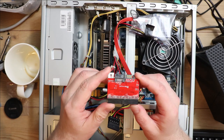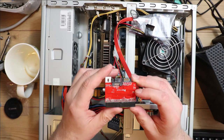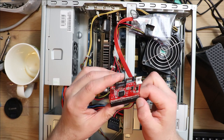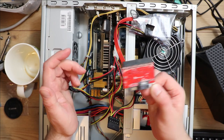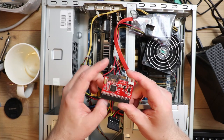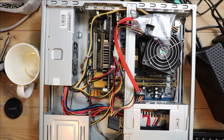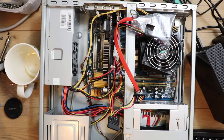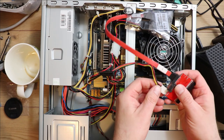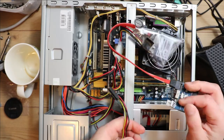Even the shutdown is slow and unresponsive — it should shut down much faster with virtually nothing installed. I also tried another red adapter and Windows fell into recovery mode; reconnecting to the main board fixed it immediately. One of the problems with that adapter could be it's crusted with solder flux, and the second time I tried it didn't even recognise a disc. So I've got two more red-chipset adapters and they may simply not be usable.